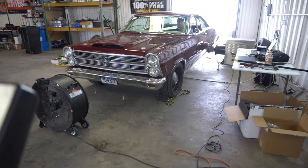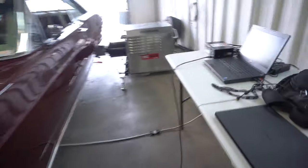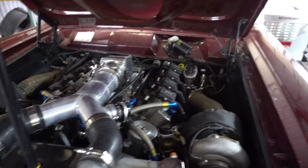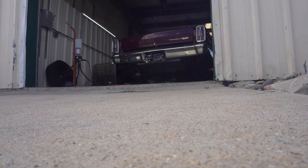They had an issue with an EGT falling off in one cylinder, so they swapped the coil to see if it's an ignition issue. Still having an issue — they're trying plug, plug wire, everything on that cylinder to figure out why number eight isn't wanting to fire. They turned the boost back down and are running at lower boost until they get it figured out. On the dyno side, more boost requires more load — overshoot the load and it bogs, undershoot and it revs too fast.